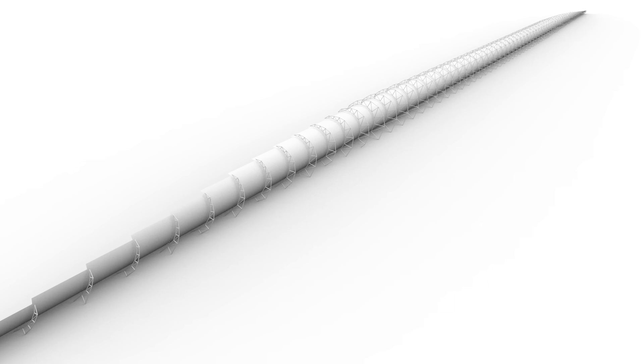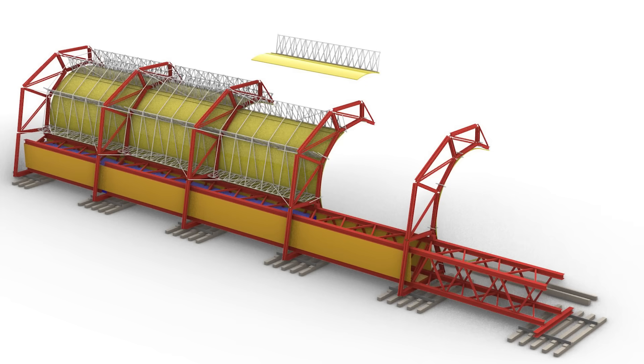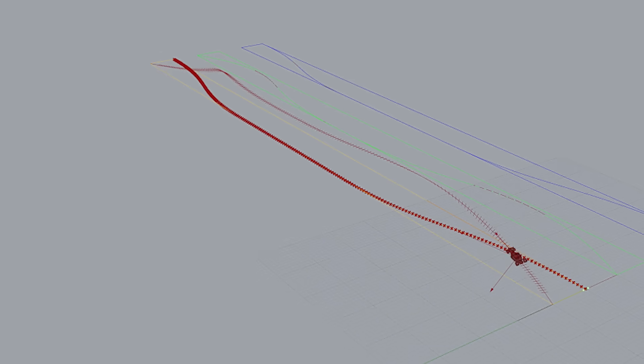We can relatively easily — because of different rules — create something that, despite being a much lighter car, has more downforce than a Formula One car at the same speed. And this is the key: peak downforce at a lower speed. The bulk of the cost of this project is building the tunnel. If we used an F1 car, the tunnel would need to be very long, easily costing multiple tens of millions of pounds or dollars. Our hill climb car, the Empire Wraith, could achieve double its mass in downforce quite easily, and Willem got it down to well below 80 miles per hour — with all the required safety margins.